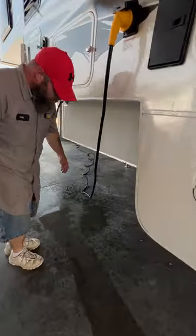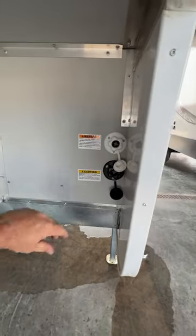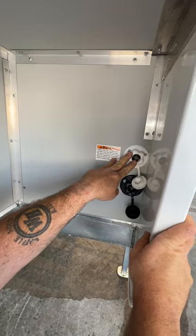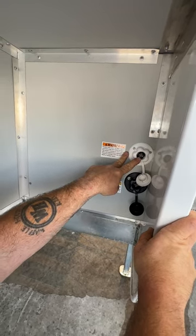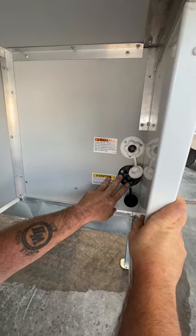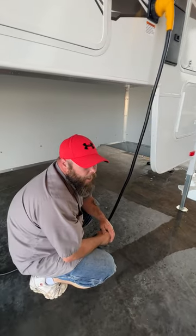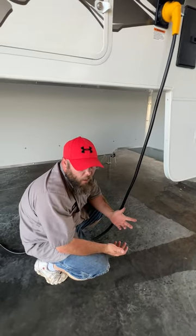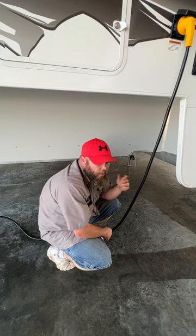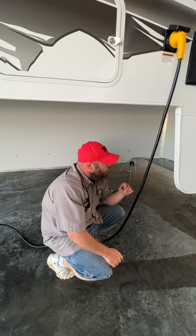Let me backtrack here a little bit. Back in this back corner here — that's why I missed it because it's hiding. Up top here is going to be your city water hookup. You always want to make sure you use a pressure regulator. Your option is an inline water filter, then your blue and white drinking water hose. Hook up to this and you'll be ready to use the water system. The one down at the bottom is going to be the black tank flush — it's a sprayer inside the black tank that sprays around and gets the nastiness out. I always recommend you want a pressure regulator on that spigot as well. Hook up a black hose — black tank, black hose, it keeps it simple. Turn it on and watch until the water comes clear out of your clear elbow that comes with your sewer hose. Shut the water off at the spigot and unhook the hose from there first, then unhook from here.